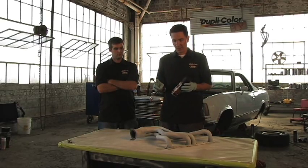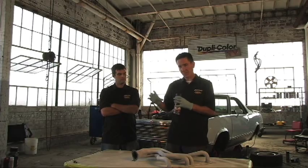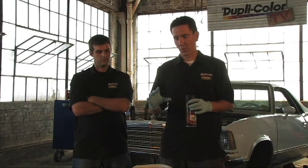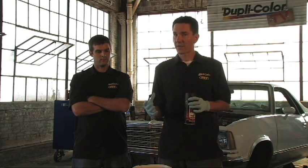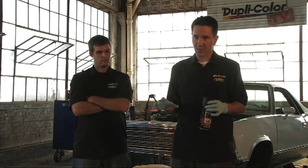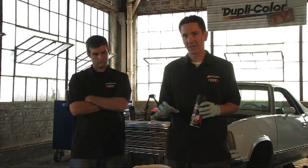There are two ways to cure this paint: off the vehicle and on the vehicle. We're going to do it on the vehicle because we don't have access to a propane grill — we're going to bolt it back on the engine. You'll want to start it up, let it idle for about 10 minutes, shut it off, let it cool down for 20 minutes, start it back up, idle again for 20 minutes, turn it back off, let it cool for 20 minutes, then start it back up and let it idle again. You certainly don't want to just start driving down the road and get it real hot because the baking process is a slow process. If it's not cured properly, the paint is going to end up peeling on you, so you want to make sure it's cured and gets nice and hard on there.